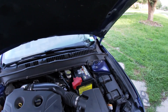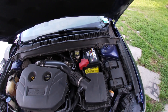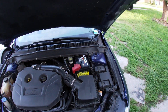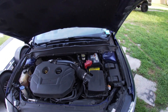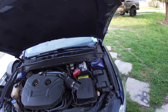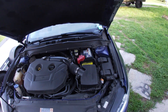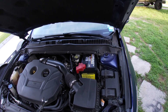And we're done. One thing to note with lithium batteries — you can no longer use any sort of lead acid battery trickle charger. You have to get a lithium-specific trickle charger or battery maintainer if you're going to connect one to this battery. The way a lead acid or AGM battery charges is a lot different than a lithium battery, and you will overheat it and damage it. Once you have the battery installed, go ahead and double-check your work, make sure all your connections are nice and tight and everything's back where it was.